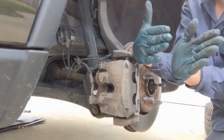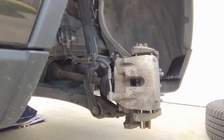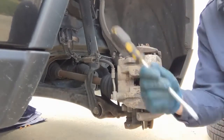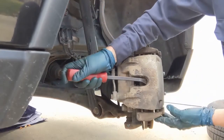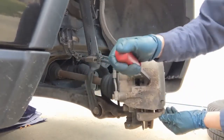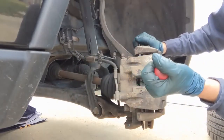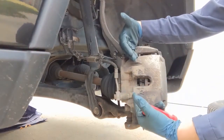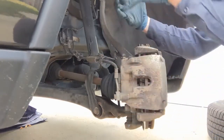Turn the wheel out so we can get to the back bolts before we pull the caliper off. We'll take a little pry bar or a long screwdriver, put it in between the rotor and the caliper, and pull this whole thing over as far as it'll go. By pulling it all the way over, I found you don't have to push the pistons in with the caliper off — this pushes the pistons in as far as they need to go already.